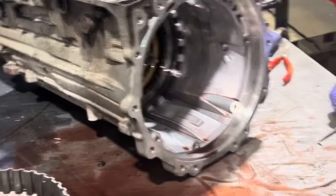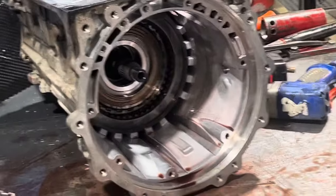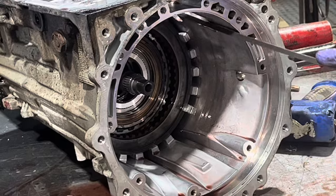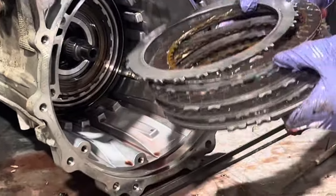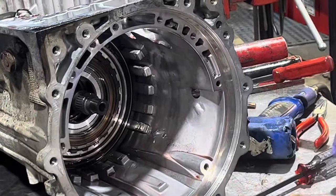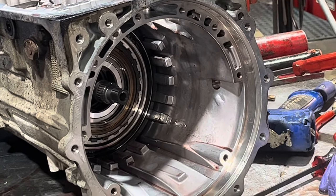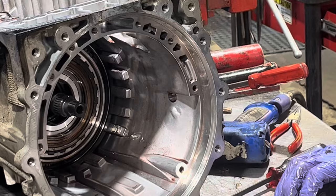Further in here — get rid of this plastic washer. These are your second gear clutches, and these are starting to cook. A lot of times what happens is people have put a supercharger on these transmissions and it affects the calibrations, and sometimes it's going to burn the clutches out. So the best bet, if you're doing a supercharger, is to get the valve body done first — it's usually going to prevent the transmission failure, not always but usually.